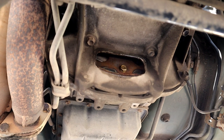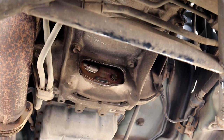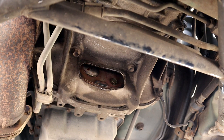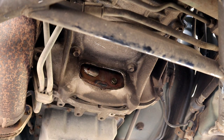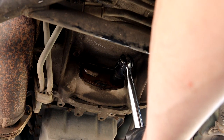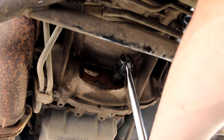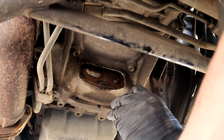I've taken the bottom engine cover off and I'm going to use a breaker bar on the crank pulley here, turning it clockwise to rotate the torque converter around. There's the next bolt. Just turning the crank until I get to a new bolt, then taking them out and repeating. I'm making sure I'm close to the edge so that when I undo anti-clockwise it won't pull it around too much.